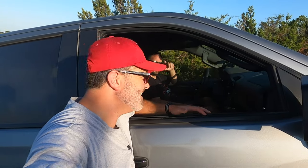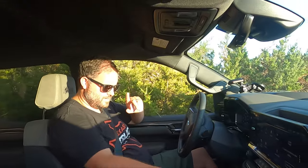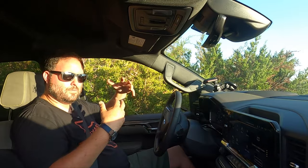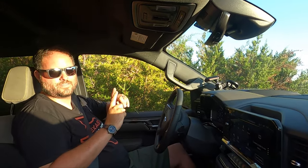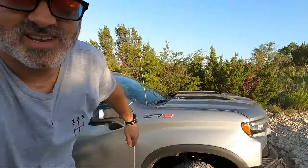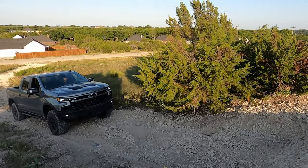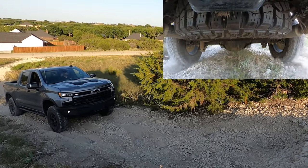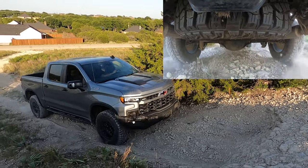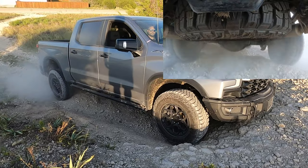The problem is pure grip. We do have the option of the rear locker in two-wheel drive, then four-high with the rear locker. We'll back up and re-approach targeting two miles per hour. You can already see the rear locker helping — both rear tires spinning at the same speed — but we're going to run out of grip at the obstacle. As expected, we need more.